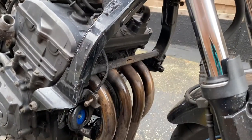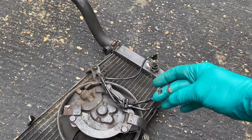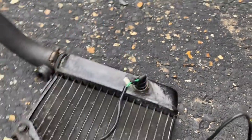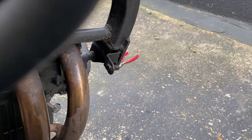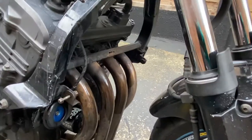The radiator is now out — it was just the top bolt and a side one. You'll have a multi-plug that connects the fan to the wiring loom. Mine was previously botched up with block connectors but yours will have a proper plug. You don't really have to take that off. The radiator sort of slides forward and pops off a peg on the side, then just falls out. It wasn't that hard.